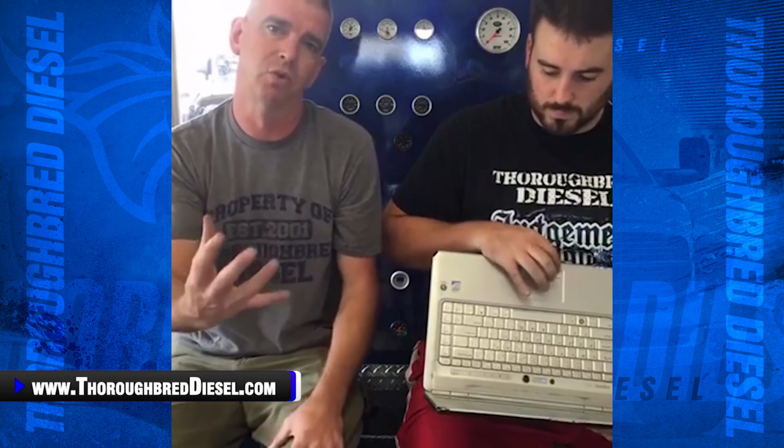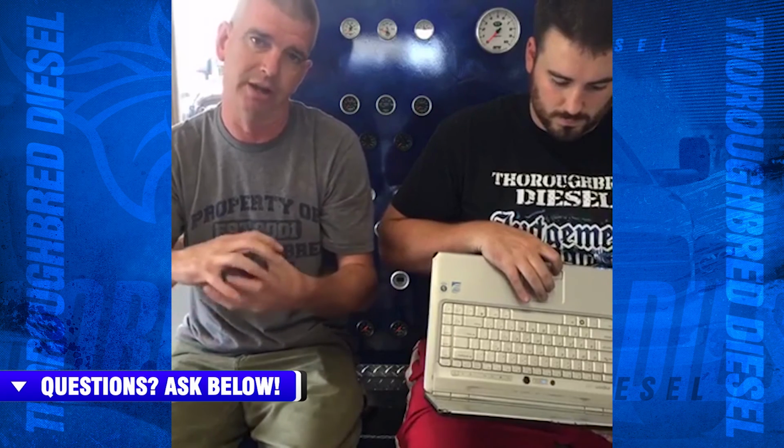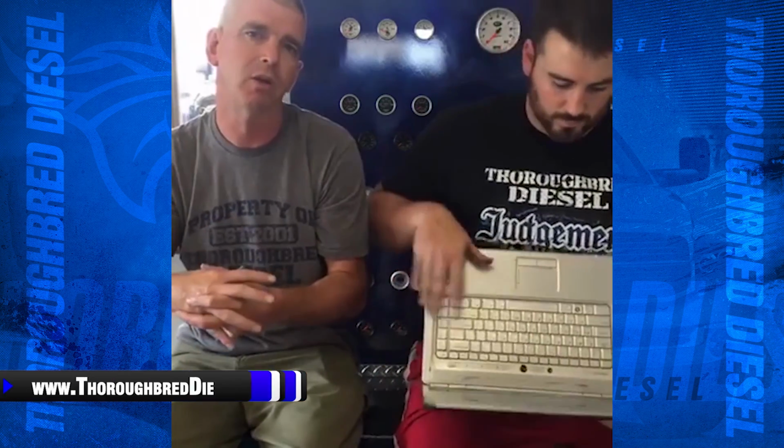But I tell you something that we see too: the driver's side, right underneath of the driver's door and the driver's side wheel well panel. Underneath of there's a bulkhead connector that has one of the main connectors going into the cab. Pull your fender well down there, look at that connector, make sure that it's not loosened up or got some water into it. So whatever you've got going on, it's probably something that's happening with moisture.